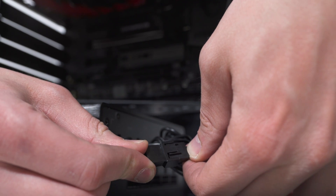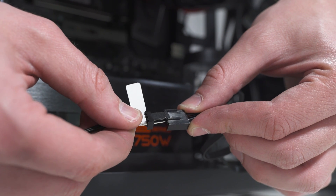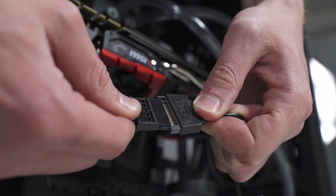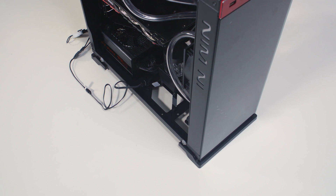Connect the EK cable pump testing adapter's SATA power header to your vacant SATA power connector on your power supply. You can use the enclosed power cable extender. The system is now ready for filling.